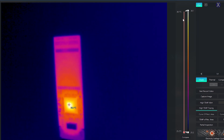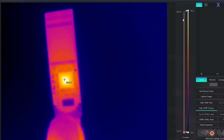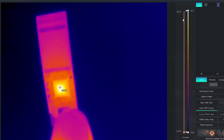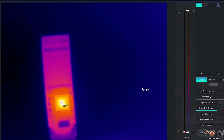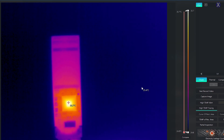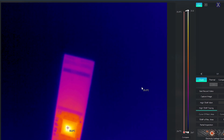If we saw something heating up somewhere else, we'd know there was another problem. Because it's plugged in, the power is going from the head of the USB to the actual controller, and it's recognized — that's why it gets hot. If the controller is bad, we can do one of two things: either get a replacement controller — though on older ones that can be harder to find — or we can read the data directly from the NAND itself using tools that will act as a controller. Let's go ahead and do that.